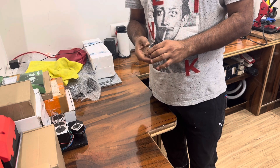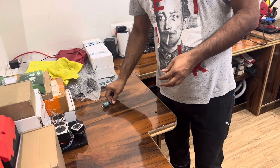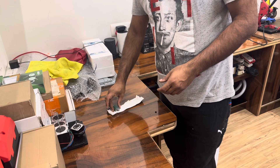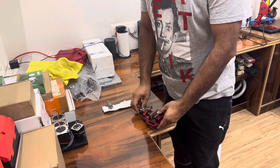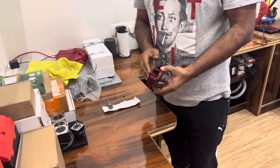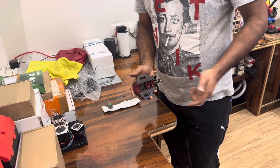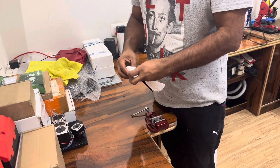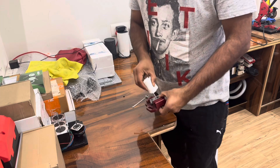The tools needed for this process are just something like a paper towel or cardboard to hold the core and prevent it from getting damaged, and a small vise. The vise is used to hold the core in the center and have space at the bottom so that you can push the shaft out. Wrap the core in cardboard or paper towel and place it in the vise.